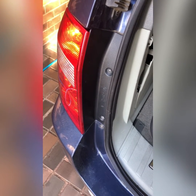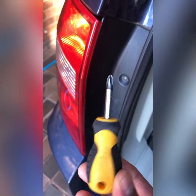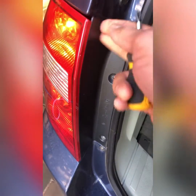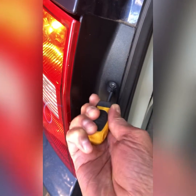Anyway, let's get started. The Ford Territory tail lights are the simplest tail lights I've ever come across to replace the bulbs on. It's as simple as getting a Phillips head screwdriver — one that fits — and it's just two screws when you open the tailgate, and you just pull it back out.